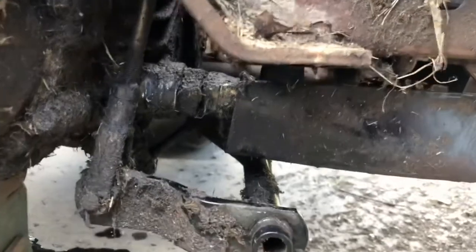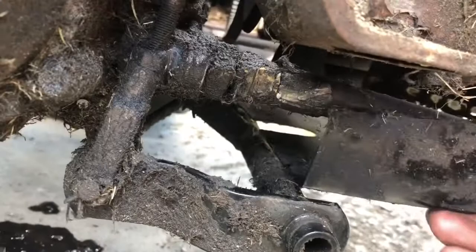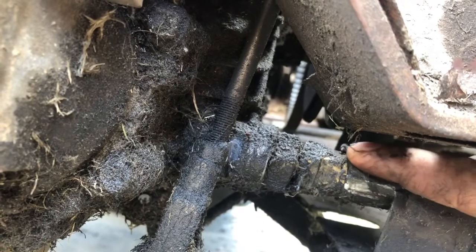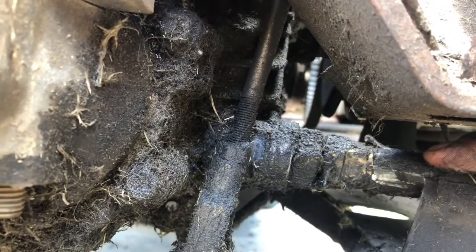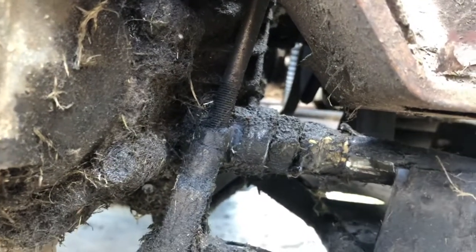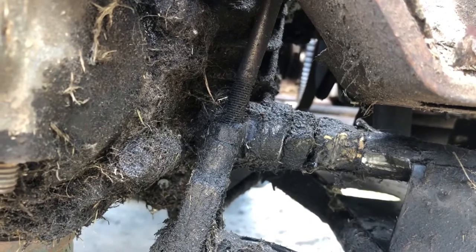So it looks like we also got another hose where the end is just about worn through. I took off this bracket here for the parking brake, and pulled away this bottom pan, and then I noticed right in here, you can see that's the sleeve that they compress for the hose, holds the hose on, and that's all the way worn through, so it's just the barbs on the fitting holding the hose on. But anyways, it looks like we'll be replacing that too, and you can see right here where it worn into the nut. So, figured I'd show you guys that too. A lot of stuff worn out here because of those bolts being missing or broken.